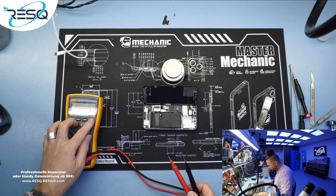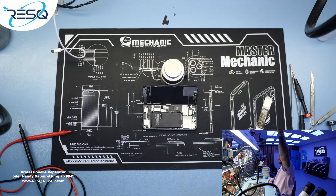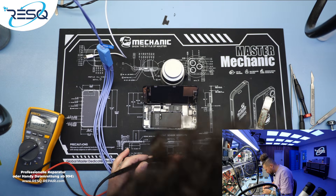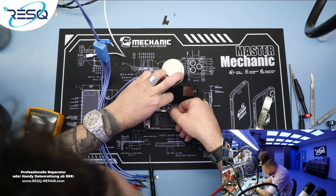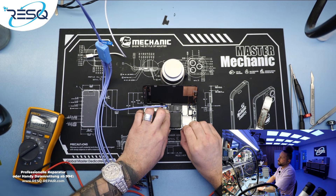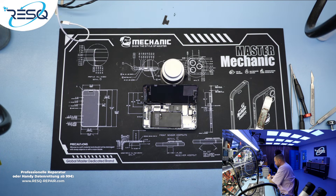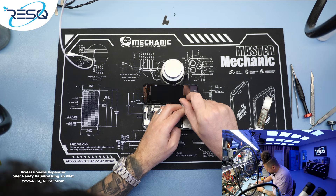I disconnect the battery first, then do a quick measurement in diode mode. On the front we have plus, so we need the iPhone 13 pinout. I connect it in the right way. If we activate, we have no short circuit on VDD main — if I try to boot, we go directly to 1.9 amps on the power supply. So we know there's no short circuit on VDD main, but we probably have a short circuit on the NAND rail.